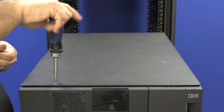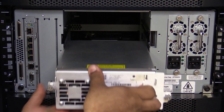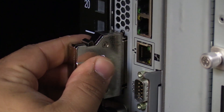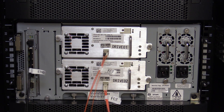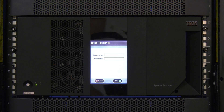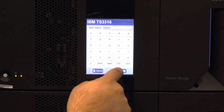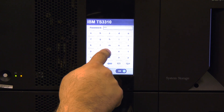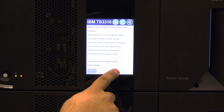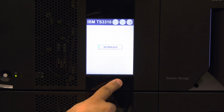Now you can replace the top cover of the library, making sure to tighten down all four Phillips screws securely. Then carefully slide the control unit back into the rack. Install all tape drives and or drive bay filler plates in their respective positions. Install the terminators, being sure that they are clipped and secure and that you do not bend the pins when installing them. Last, install all cables that you removed prior to working on the library. Flip all power supplies to the on position and then go around to the front of the library and press the power button and wait for the library to initialize. You must make sure that the library comes up clean without any errors. If there is an amber light below the operator panel after the library initializes, you will need to log in as an administrator and examine if they are related to the work that was just performed and clear them. If you have any questions in regards to examining and clearing operator interventions, please see the link in the description below for our video about 3576 operator interventions. If you are having any more difficulties after this, please open up a support ticket through the Rocket Plus customer portal.